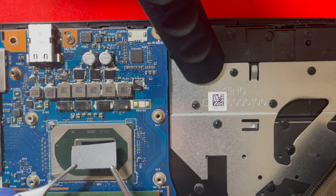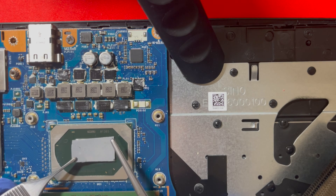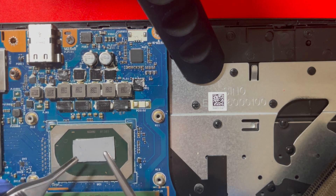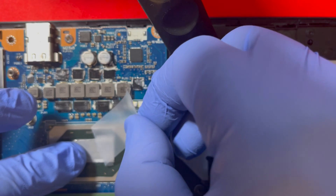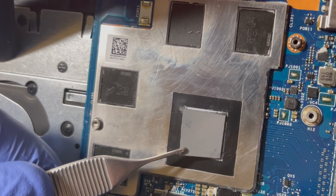This is the tricky part. You can use the included tape or 3M scotch tape to help you remove the protective film. My finger accidentally touched it — luckily I had gloves on as usual. The easiest method for me was to remove one side first using a needle, then apply. Once on the processor, use a needle and forceps to remove the top layer. The warmer it gets, the more difficult it becomes to work with.